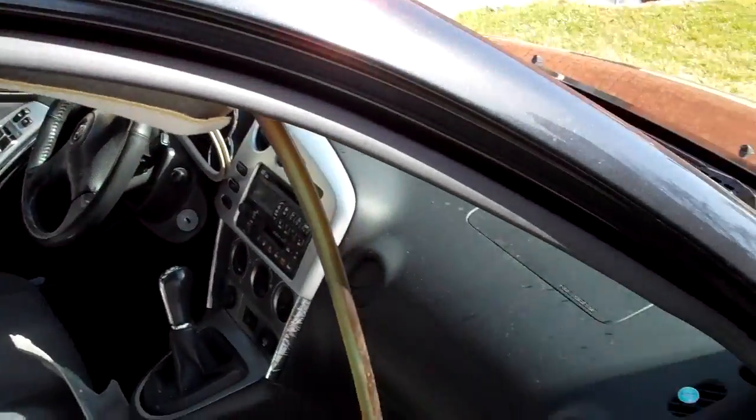So it's not the tube, it's not the sunroof, it's not the weather stripping, it's nothing else other than the windshield. See, look at this right here. You see the cracking along here? You got these little cracks and these little cracks all the way across the top. That's why it's leaking. It's a windshield seal for sure. Problem and case solved.